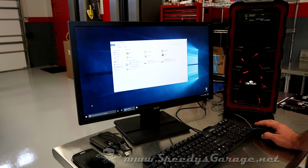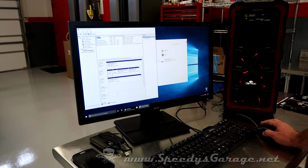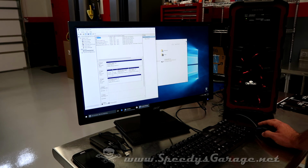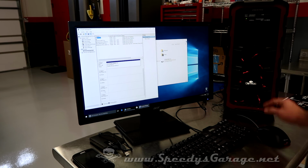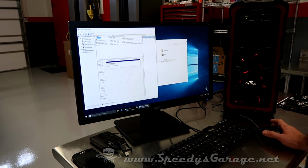And you may have noticed some of those other ones. I'll show you this real quick. This is how you get to your disk manager. You'll see a lot more drive letters on mine. You've got a disk 4, removable W, X, Y, and Z. That's actually this guy. So those are the removable drives. It reserves drive letters for those, even though there's no disk plugged in.